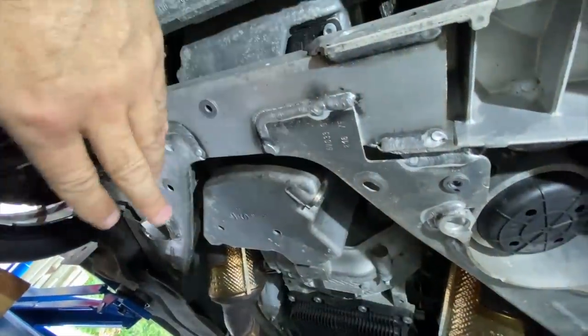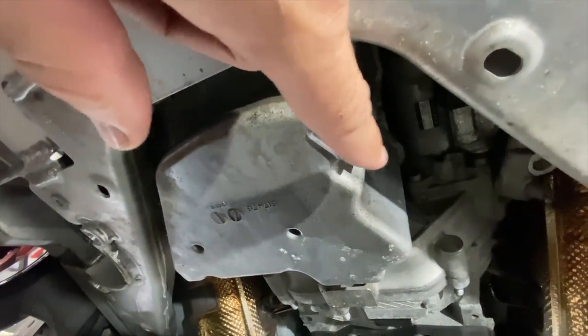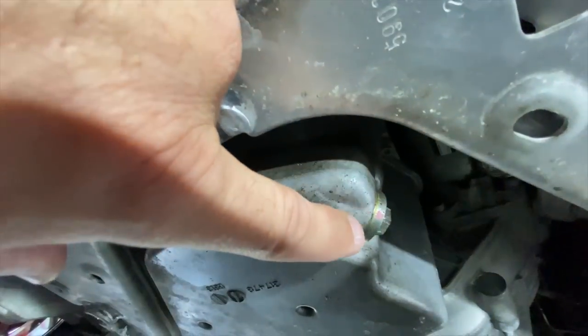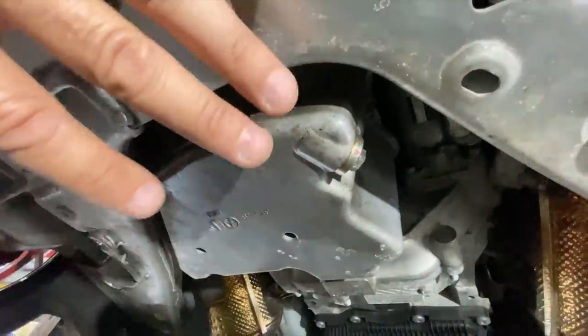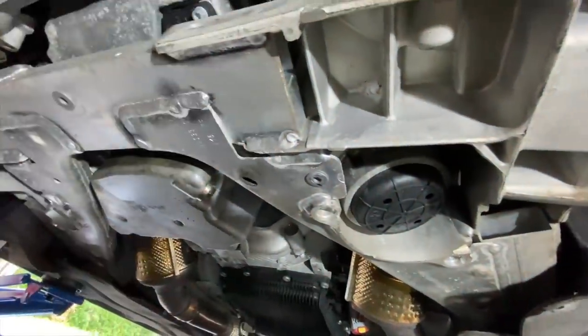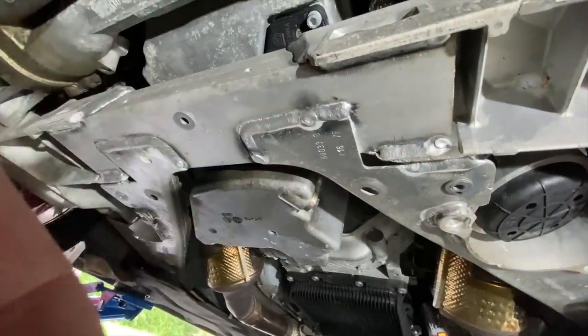The under-tray is removed. This is where the oil will be drained — you can see some residue from last time. We're also changing the compression sealing washer. There's a paint dab on the drain plug so you can tell if it ever comes loose. Before draining, I'm going to clean up this area with mineral spirits. It's also a good idea to inspect for leaks, broken parts, or any debris on the bottom of the car and chassis while the tray is fully removed.